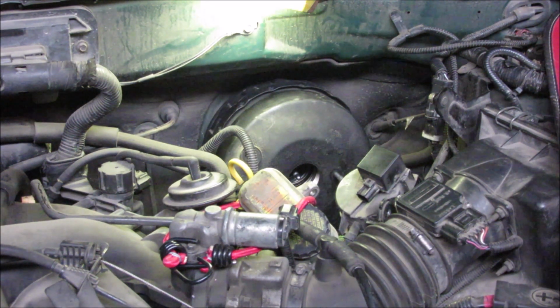All in all, it's replaced the 4 bolts on the inside. We got to put the master cylinder back on and get that brake pedal up in there. So it's all reverse of what you've already done to pull it out. If anything changes or there's a little tip or trick, then I'll come back and tell you about that.